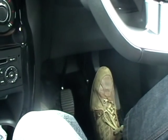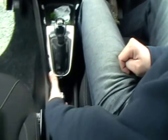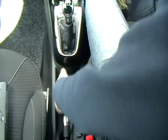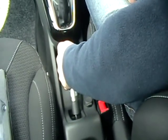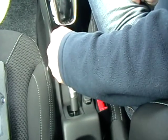Show me how you would check the parking brake or handbrake for excessive wear, making sure you keep control of the vehicle. Firstly, depress the foot brake, then place your hand on the handbrake and take it fully off. Then explain to the examiner that the handbrake needs to come on so you get some resistance and it locks into place. The handbrake should not come all the way up — it should not reach the end of its travel.